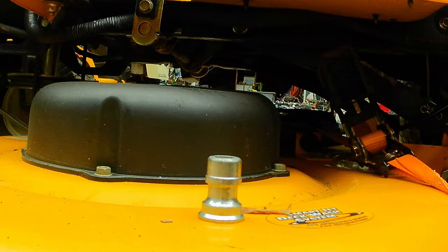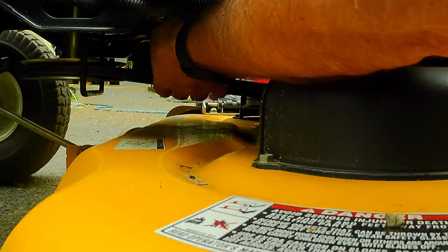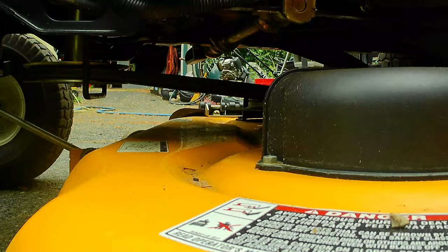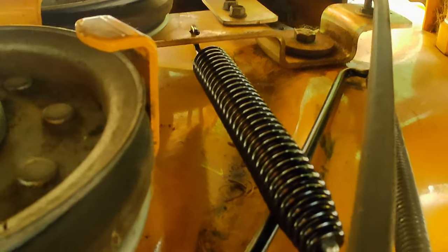It's still a little tight. Now I have it engaged and the belt should be tight - and the belt is tight. That tensioner needs to be lubed up a little bit. I think it'll work like that but it needs a little lubrication on the pivot, because the tensioner does not spring back like it should. We'll spray that a little bit - right there at that nut at the end of that arm - that's the pivot. We're going to lube that up a little bit and see if we can get it to spring back better.